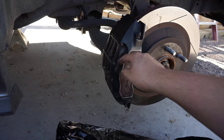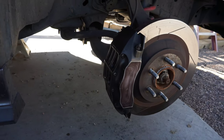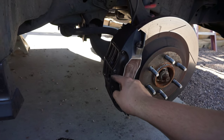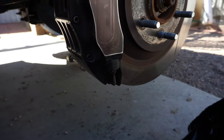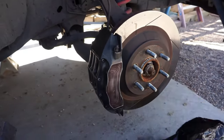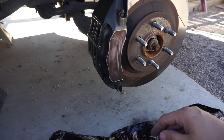These metal pieces I was gonna try to mask or take off, but the caliper might come apart. There are three bolts up top and on the bottom, but I don't wanna risk breaking anything. So I might just spray it and then take a razor blade to carefully clean off just the face of those bolts. The other tricky part to mask is the little brake line hose here — that's gonna be a pain too. So once I get all that masked, we'll start spraying and see what happens, fingers crossed. Hopefully it looks decent — kind of a five-footer situation for the work we're doing.